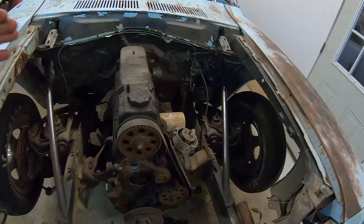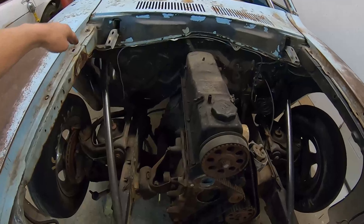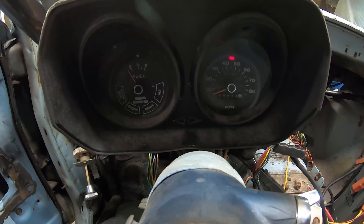We made some progress. I did all of this without any wiring diagram — it forces you to trace every wire point-to-point from A to B — and it's a good thing because there were a lot of places where the wire had chafed, or mice had chewed it, or it had melted. I went one wire at a time, cut off what I didn't need, and by the time I was done only five wires came out under the hood. I pulled everything through, moved it to the back side of the firewall, ran it under the fenders, and added a connector under there so if I ever do a one-piece front clip I can use the same harness. Now I've got working brake lights, tail lights, turn signals, reverse lights off the shifter, headlights, high beam and low beam with the indicator in the dash.